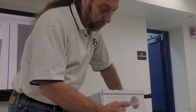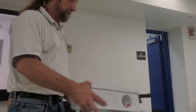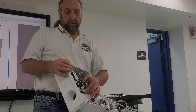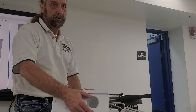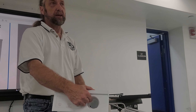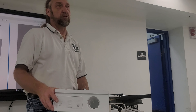In the manual you can press some buttons and go into diagnostics, but I'm not going to go through that today. Now, if you look at this piece right here, inside there's a switch — it's the same as a refrigerator light switch. If the filter is not installed, it won't let the ice maker run. It's not just to force filter purchases — the hoses are connected to the inside and back, and if the filter's not there, water will just shoot out instead of going into the reservoir to make ice.